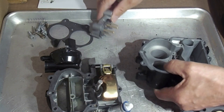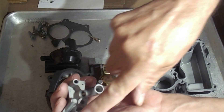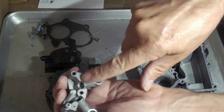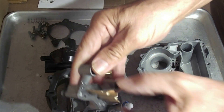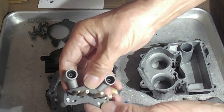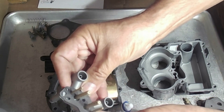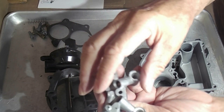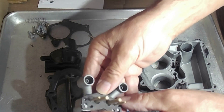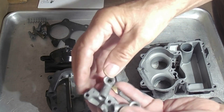Make sure it comes up through the edges and the holes here. Air eventually comes up through these two vent holes right here — these are your idle vents — and if they're not clear, you're going to have a rough idle. Also make sure these gaskets are sitting flat. With our kit you shouldn't have the wrong gasket, as we have a gasket that fits all of them.